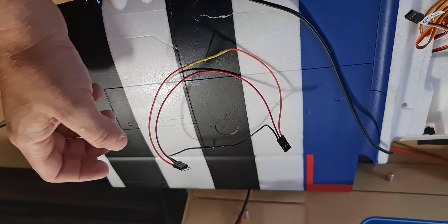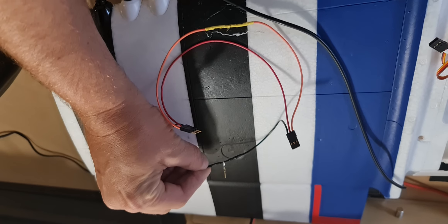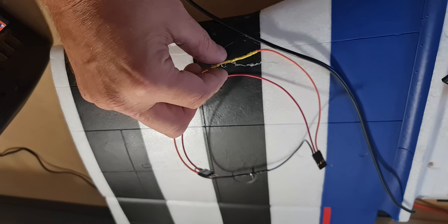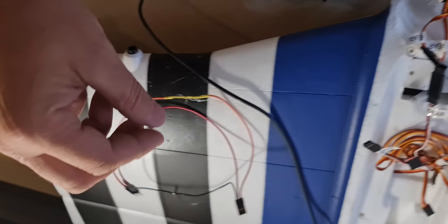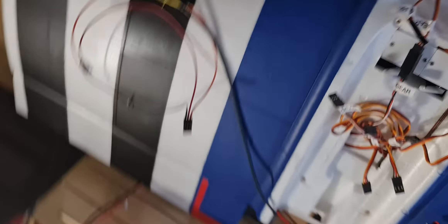This is my little device — I use these pins here, just JST connectors soldered together. That one there, and then I can just tap into that with some alligator clamps connected to my multimeter, and that'll just tell me what's working. Hope that helps, cheers.